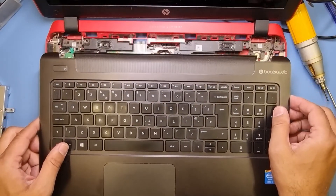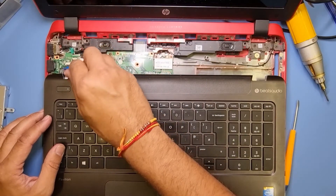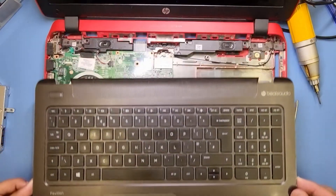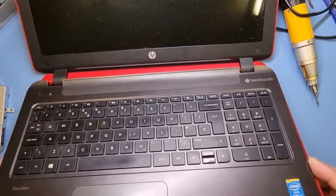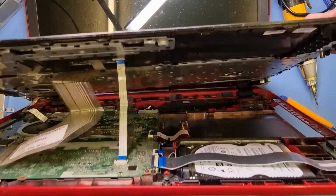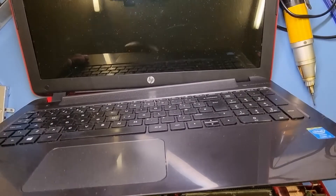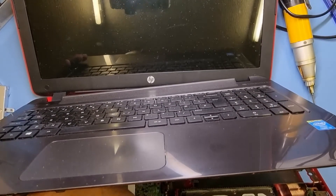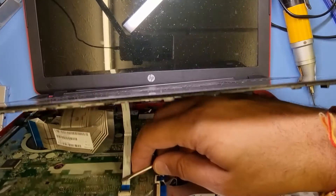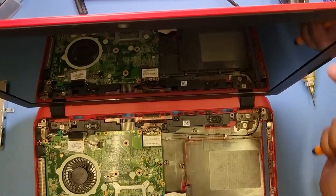Slowly pull this here — you'll see this is for the power button. Lift that off, open the door and that's popped off quite easily. There will be some flex connectors there, so get those off. There's the keyboard flex, which is that one there — that'll come out easily. And then you've got the mousepad flex, which is just there. That should come out easily as well. There you've got the keyboard off.